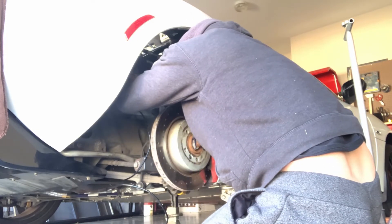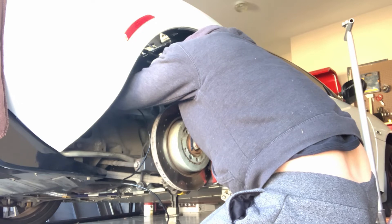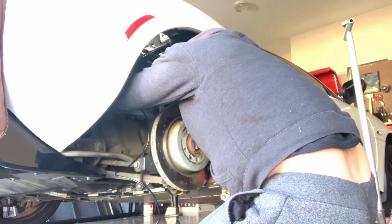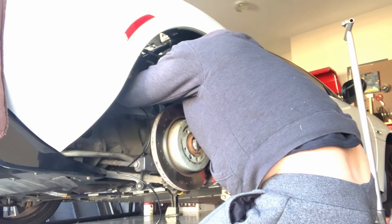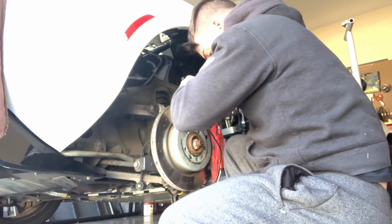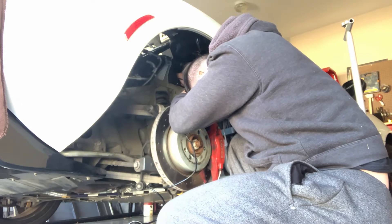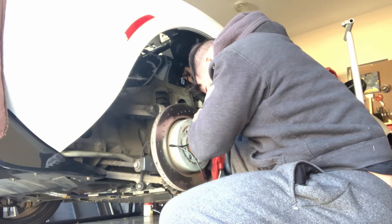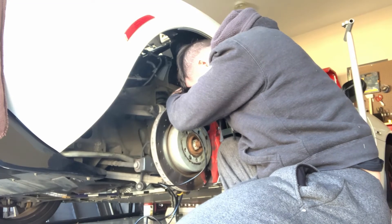You don't have a ton of room to work here. The second reason I wanted to show you this clip is I got out my little digital camera — it's got a little light on it — and I just traced my belt onto each of the pulleys to make sure my belt was seated completely right. I didn't want any crossing of the splines of the belt and shredding my belt up on startup. Also, just keep in mind: be patient. Your car's not going anywhere at this point — be very meticulous in every step you do. I went over it about three times because I was very nervous about shredding my belt. Go slow, and make sure you're doing things right the first time.